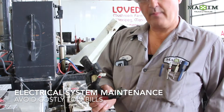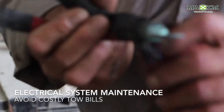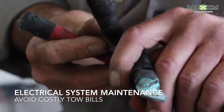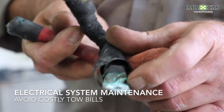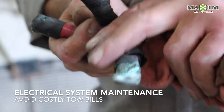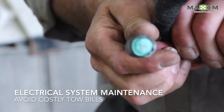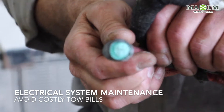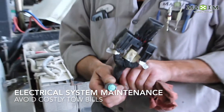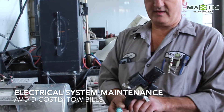Here's a good example of what can happen underneath all of the dirt. This is a battery jumper — not particularly from this model, but it's a good example of what does happen in your battery box. Here you can see sulfating taking place on the copper terminal that links to the battery. In an extreme case, that copper sulfating can completely rot the terminal off, which can kill the engine. So it's a good idea to keep an eye on these battery terminals to prevent this from happening.